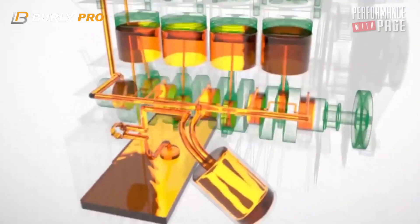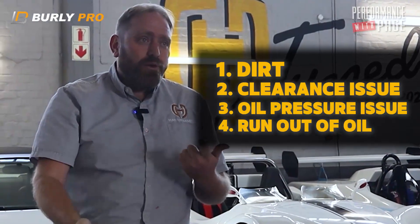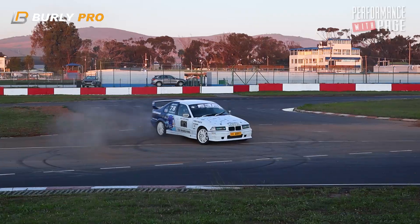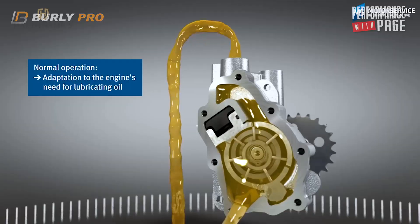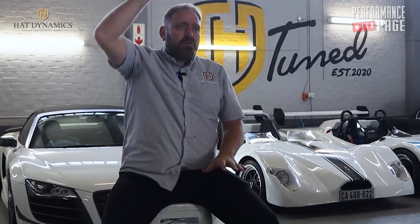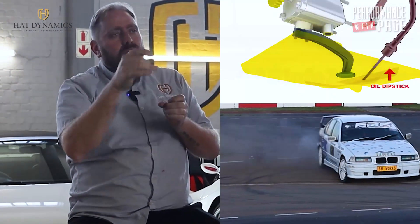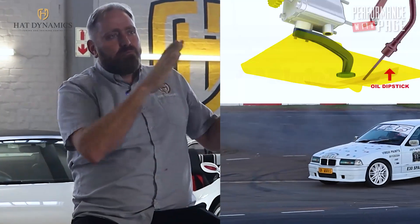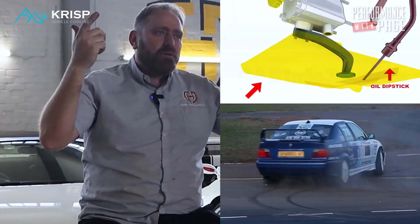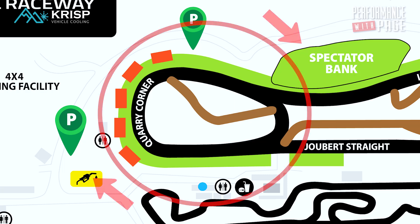So it's either dirt, clearance issue, oil pressure issue — your pump isn't supplying the right oil pressure to keep that line of oil there — or you've run out of oil. What happens is guys throw donuts, donuts, donuts and they fill the tappet cover up with oil. Your four or five liters that were in the sump are now up in the cylinder head because you keep turning one way and the oil drains down the side of the block and can't drain back. You end up sucking air at the bottom, putting aerated oil onto the bearing, and you run a bearing.